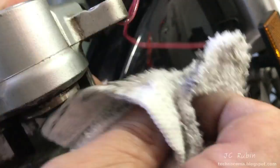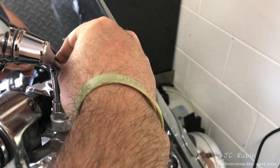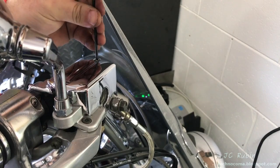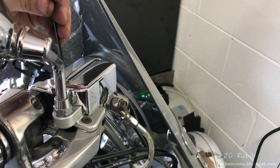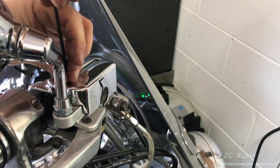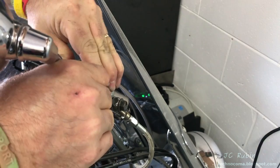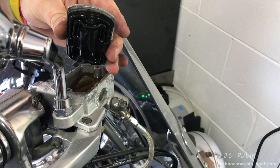I kind of shot it out a bit — that's fine, I'll go get it. I'm going to clean up under where the spring was first, and that spring will be cleaned before continuing. It's important that we inspect the brake fluid level in the reservoir, so I'm going to open up my reservoir using a 3.5mm hex key. As the brake pads wear out and the pistons push outward more to compensate, the fluid level drops. If you've been keeping your fluid topped up and the fluid level is right at the top when we push those pistons in later to reset them, it may raise the fluid over the top of the reservoir.